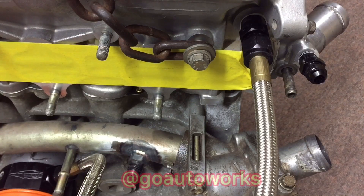Now I've got both pieces back on the motor. I'm in the clean room — you can see the water pipe is back on and bolted in place. This is a Golden Eagle sleeve B20 block that we had assembled; it's 10-to-1 compression with a stock B16 A2 head out of the Civic Si, which is what this engine is going back into.